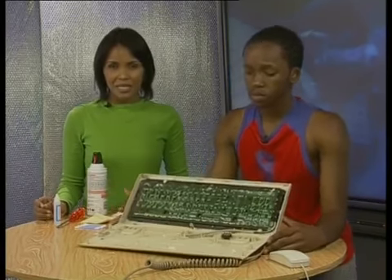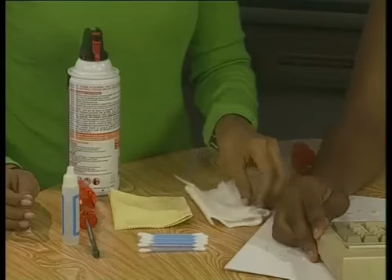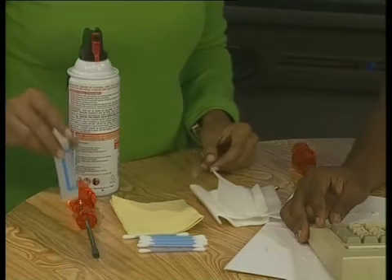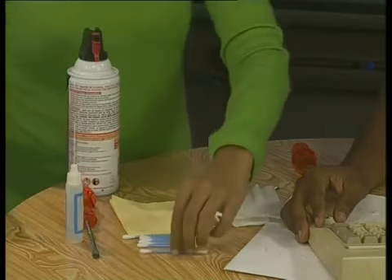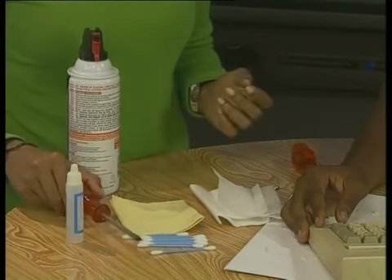Good. Now, aside from food and drink, the keys of a keyboard do get quite dirty. Sometimes the dirt comes off your fingers when you type, sometimes fluff comes off your clothes, and sometimes dust and tiny bits of dirt fall out of the air and land between the keys. To maintain your keyboard properly, you should clean out all this grime every now and then. This is what you will need: a lint-free cloth, a dry cloth or duster, a suitable cleaning fluid like isopropyl alcohol — available from any computer shop — cotton buds, a can of compressed air, and a flat-tip screwdriver, although this is only needed for a very thorough clean.